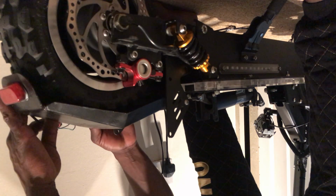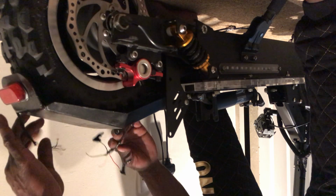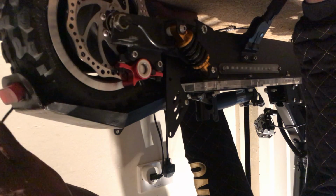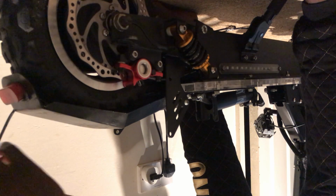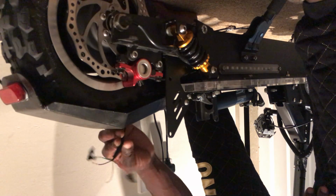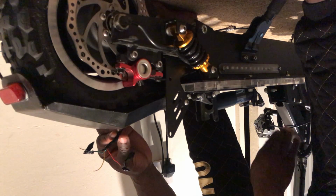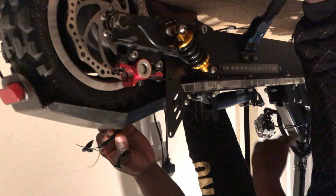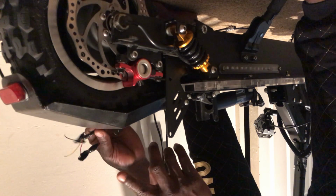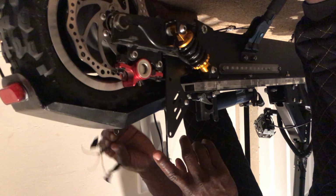If you connect them outside, you can put it in, but if it's too short, you're gonna be having problems. So you put it in first, then later you connect, and make sure this one is tight because there's no power flowing here. So when it's tight, there's no problem. But this one here, you have to make sure they're not touching because they still have power. The battery is still on, even though the scooter is not on. So it's the power flowing through this. You don't want them touching, so you separate them and put them somewhere very nice.